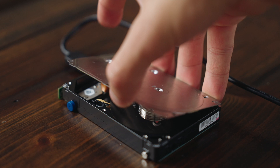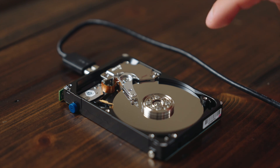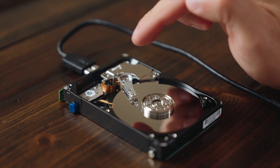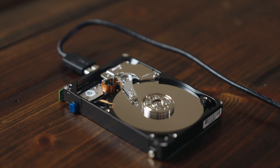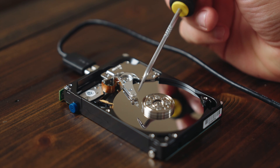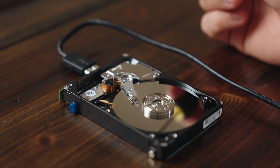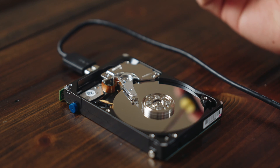It's now free and you can just gently pry it off. Immediately I can see the problem with this hard drive. We have the disc right here — we don't want to touch this stuff. You don't want any dust or particles collecting on the disc itself, and you don't want to further damage these components as they can definitely be fragile. The read heads are supposed to be right here — these are the read heads. They're stuck on the disc, and that's why we're hearing that beeping sound. They're supposed to return to their resting position when they're not reading or writing information on the disc. It's also possible that the heads themselves are damaged, but this is a good first thing to try to fix the hard drive.